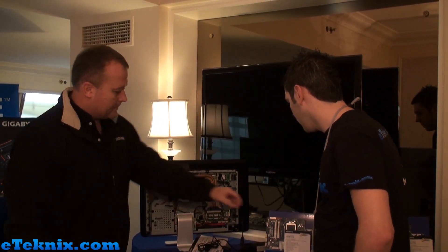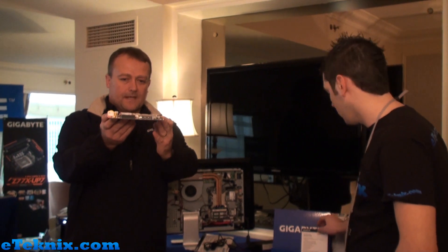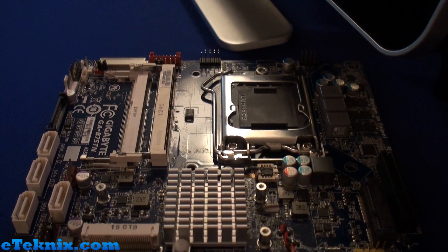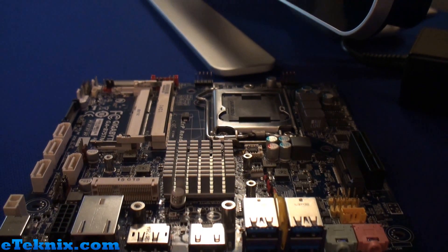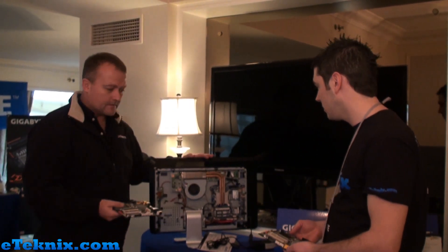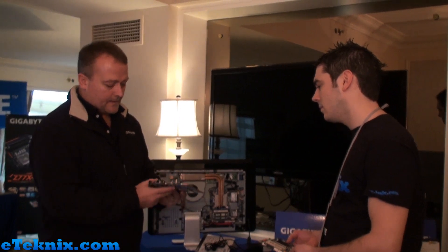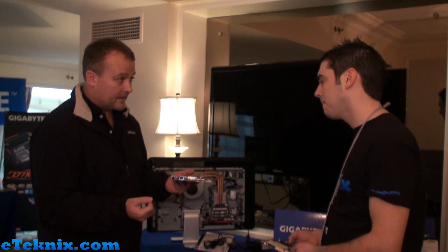What makes this possible is a very low-profile Thin Mini-ITX motherboard. You can see it looks like a normal motherboard — it's got a CPU, SODIMM memory, and all the connectivity you'd normally expect like HDMI, DisplayPort out, and USB 3. It also has LVDS, which is the monitor connector that allows this touchscreen over here. Gigabyte has made this motherboard particularly special because it supports 19V, which is the Intel Thin Mini-ITX spec.